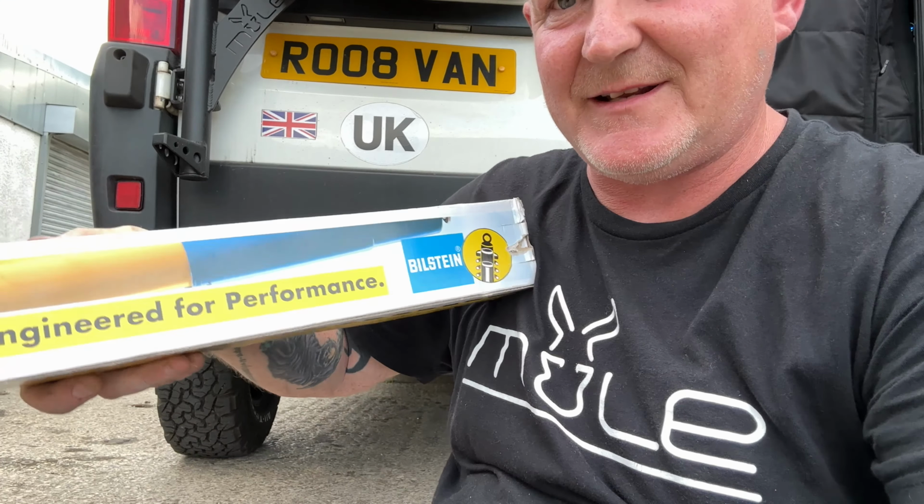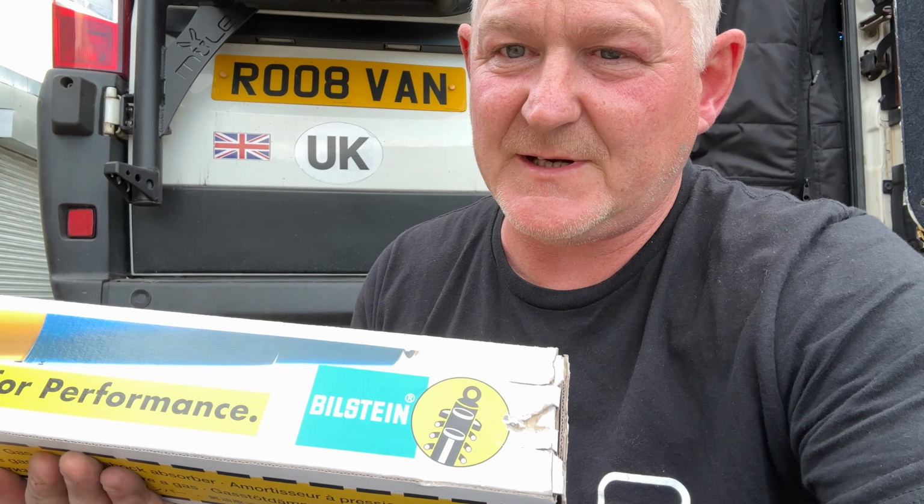However, what I am gonna do is, I have some Bilstein performance, engineered for performance rear shock absorbers. So one of the days this week, hopefully before the weekend, I'm gonna get the van jacked up, get the wheels off, and take out the original oil shocks that came with the van. They've been on there for a couple of years. One of them is misting, which means it's leaking oil. So these are performance gas shocks for the back. I'm literally gonna put them on. I'll leave a link if anybody's interested. I think it's £225 for a set of these Bilstein rear shocks, and I'm hoping that they will make a massive difference as well.